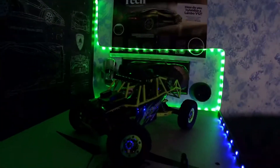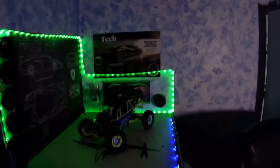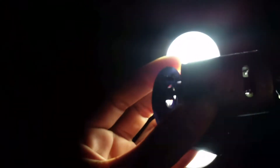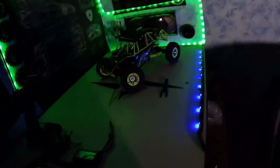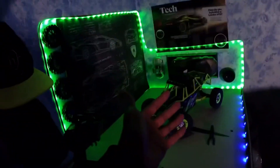Anyway, this is me. I go by EJ, I'm the Dude Sporado. I got this car about two months ago, drove it for one week, then it broke. The ESC just completely gave out and the motor's absolute garbage — through the motor you can actually see daylight. I drove the car through some water and the ESC really didn't like that, so it decided to destroy itself.